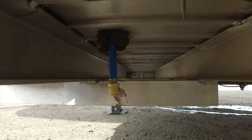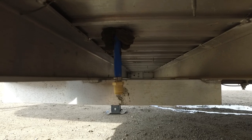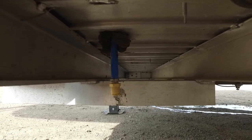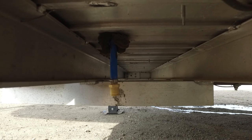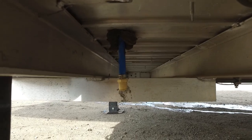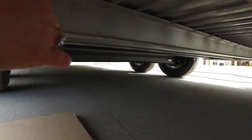So we take the cap off of that. Looks like this one hasn't been used a lot. And I'll let that drain, and we'll take this cap and put it in the same place that we put our rod — in the water heater door. If you have some low-point drains, hot and cold, it would be near your shower base. So that's what we're going to do next — just take a look at those right here and do the same thing.